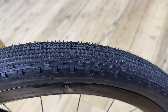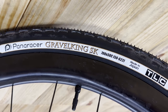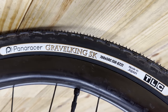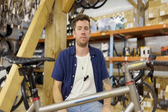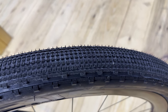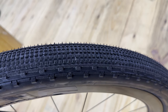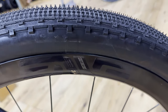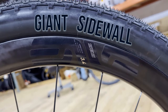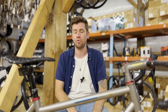Wheels and tires on this bike: Envy 3.4 carbon wheels laced up with Gravel King 700 by 50 millimeter tires — my particular favorite tire for riding in the gravel. They're lightweight, even at this size, very cool tech, tubeless, and also very affordable. I love the tread pattern — it rolls really well and hooks up on dirt or snow when you lean it over. The coolest thing about these 700 by 50s is not just the width, but the actual diameter of the tire is so large that this thing will roll over just about anything, which is great for New England.